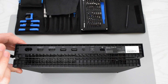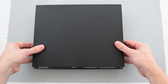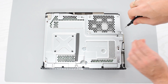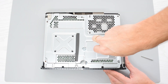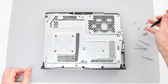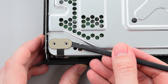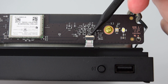Let's go ahead and start by removing these two screws. Then slide the cover forward and lift it up like so. Next we need to remove these 19 screws. Carefully lift the bracket attached to the cable, and then disconnect the cable from the rev board.